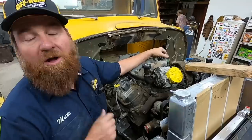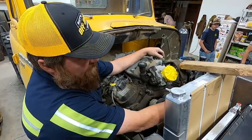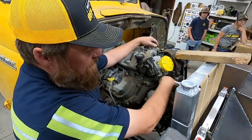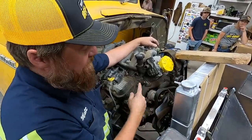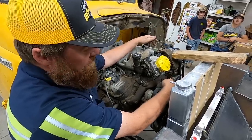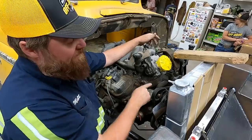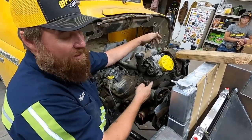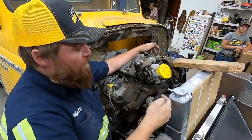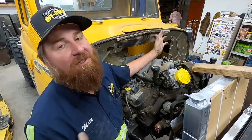All engines have some kind of a fast warm-up device and this one is no different. It runs the hot water — when the thermostat's closed, the water that's warming up goes straight into the cold side of the pump and recirculates. Once the thermostat opens, we're going to interrupt this flow and run it into this tank so they can recirculate just like normal. But once the thermostat opens, the in-rushing water will go in there and suck right into the pump. It's going to be amazing.